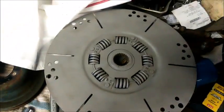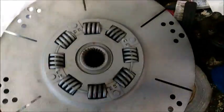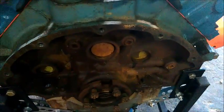Anyway, what I've done is I took this, which is a coupler plate. Some people call it a vibration damper because it absorbs the shock of going into forward or reverse, or even from neutral, or if you happen to hit something with your propeller. And if I sound a little funny, here's why. I look like a Frito Bandito, just without the sombrero. Anyway, that piece of metal used to look rusty, and this is what it looks like now from the sandblasting. So you see the other work I've already done up here.